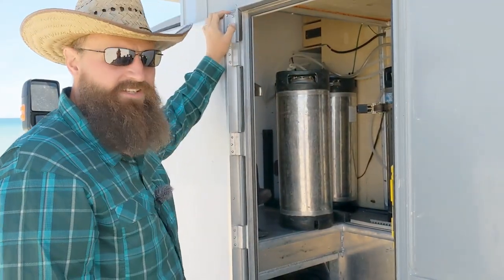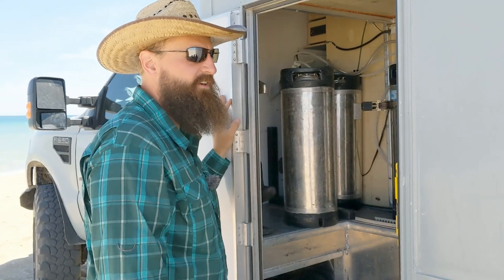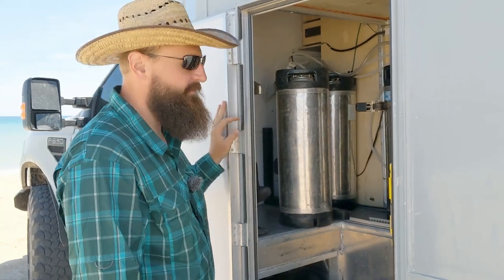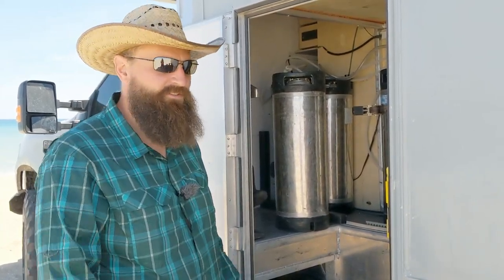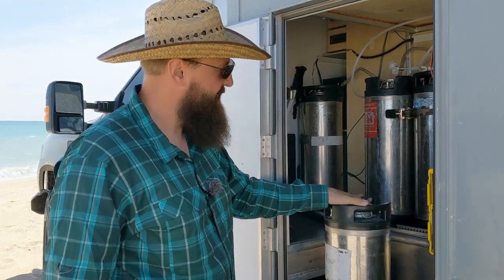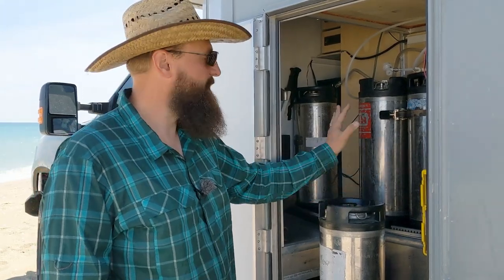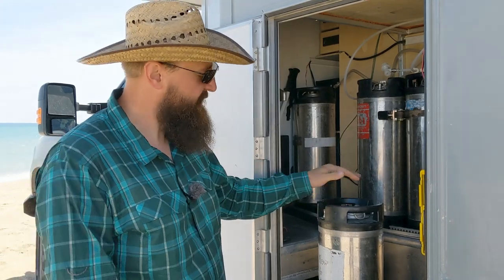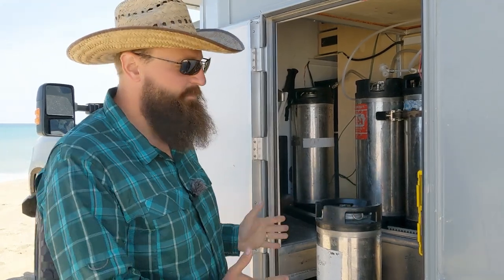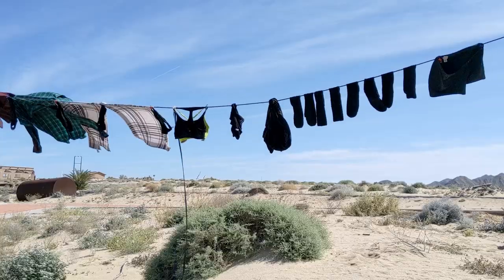Another reason the kegs are inside is freeze protection — they're inside the building envelope, insulated inside our living space, so when we're camping in freezing weather our water and all our lines are inside the heated compartment. The other really neat thing is we can segregate our water: if we have fresh clean known-good drinking water, I can keep it in certain kegs, and if we pass a stream or some questionable source, we keep those separate and filter as needed or use for non-potable uses like washing off the dog.